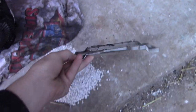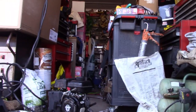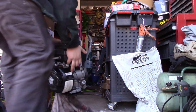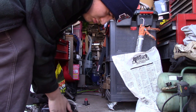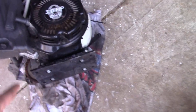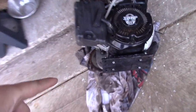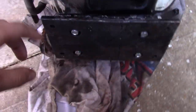This is the original mount bracket for the go-kart engine, and we decided to basically make a new one. The easiest way to do that was with four pieces of quarter-inch plate steel welded together and cut to the right size. These are pretty much flush, a little bit sticking out, but I think we'll be okay as far as mounting goes. This is going to be a lot sturdier than the original.